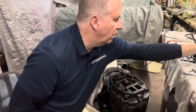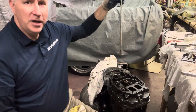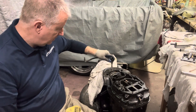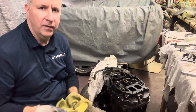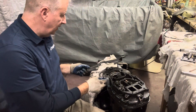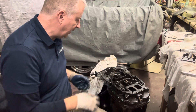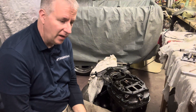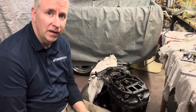Then we'll hoist this up onto our stand and get the engine block ready to go on here — so we're coming to that point. Oh, it would be nice if we put our shift shaft back in. Definitely want to make sure that's in place before we go ahead and mount the motor. And there is also a bracket here — we'll clean this up a little bit. This bracket goes on here; we'll get those bolts back in there. We cleaned those out and ran a tap through those nicely too. So then we'll continue on with this project soon. We'll be getting ready to drop this motor on here and put the finishing touches on it, put the lower unit back on. We have a new water pump for the lower unit, and I have to get a couple of thermostats — that's pretty much the only parts I think I need to order. And we'll be ready to run.